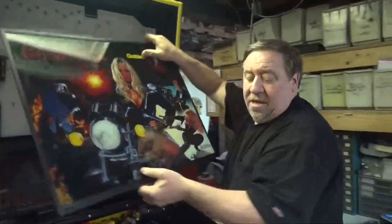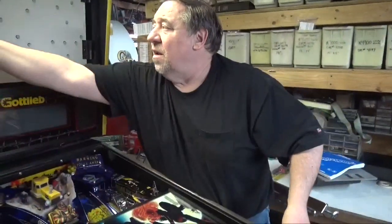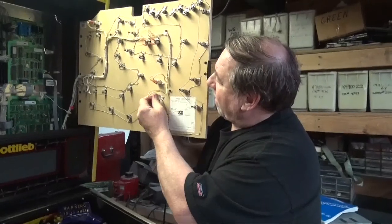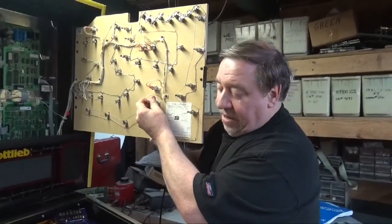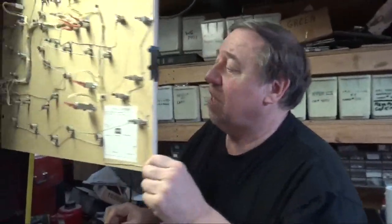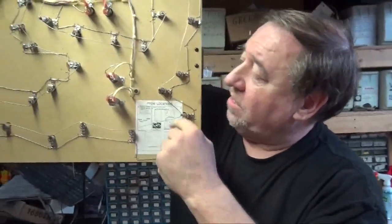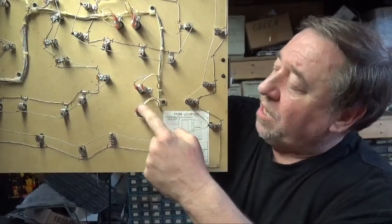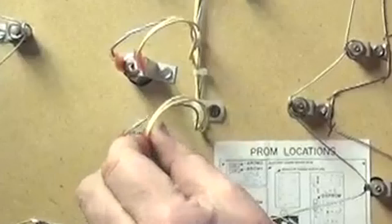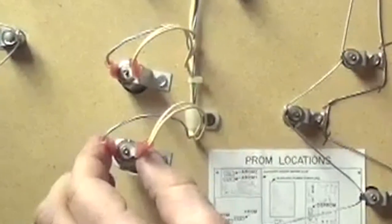When you're buying your LED flash lamps, you needed that last one pointing in here like that. That's right. He has that set back on purpose, so it lights just the headlight. It's really clever. Very good use. When you put these LEDs in, you sometimes have to switch the plus and minus, the ground and the feed. So if your LED isn't flashing, you have to switch it.